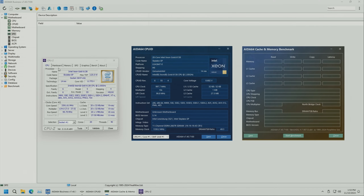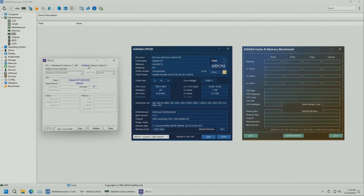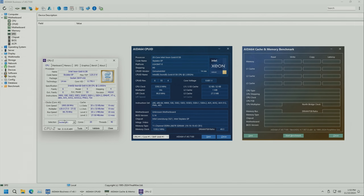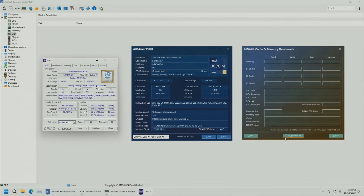The damaged memory slot did not stop me and I conducted some extra testing. All detailed results you will find at the end of this video in my slides. The motherboard does not support sleep mode, and even though we have eight 4-pin PWM fan connectors, we do not have smart fan function. So it is not possible to manually adjust the fan speed — it always rotates at an automatically adjusted speed, which is pretty noisy. Also, 3-pin fans are not controlled whatsoever.